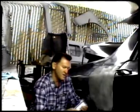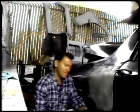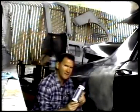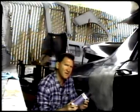The finishing touch, or another step when we're finished with the Bondo, is we put guide coat. It's a visual guide for a uniform surface. What we do is, once we get the Bondo smooth again, the time that we think it's smooth and lining up with these two sections, we spray. It's like spray paint, and it gives you a guide. You put it on, and then you sand it down, and once all the black paint is gone, you're smooth again. You're down to a flat surface. You can do this a couple of times, but if you've done it a couple of times and you're good at it, it comes natural.